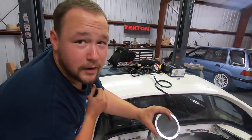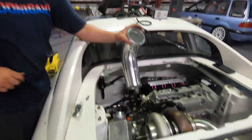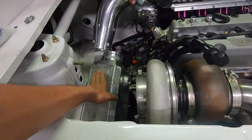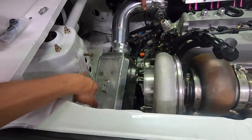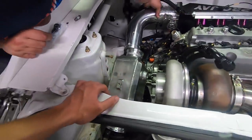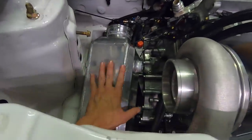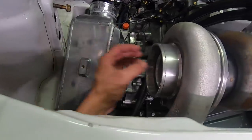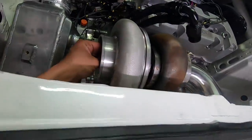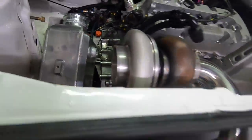It's a bit of a sad day — we're going to cut up our brand new Precision Turbo. We're going to lop that V-band flange right off and weld a quick release clamp flange onto the compressor housing itself. But that's what you got to do. We're also going to have to figure out some way to mount the intercooler — thinking about making a brace off this existing mounting point and making something underneath to support it. The intercooler will hang pretty low, so air won't be restricted coming into the turbo inlet.